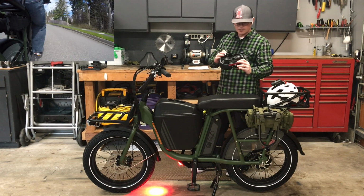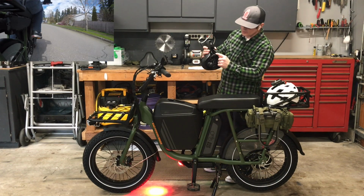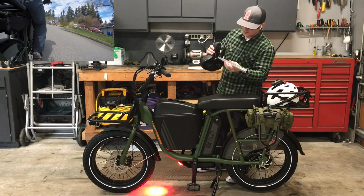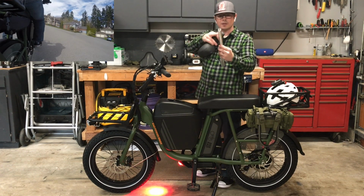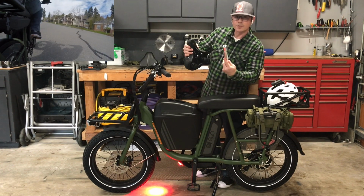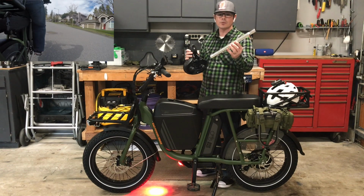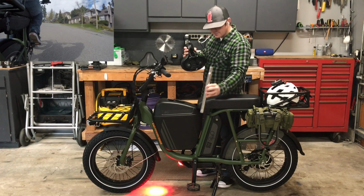Again, I wish I could use this. It just doesn't work. It sits too tall. The seats do come with a hole for the peg to go in for the post, just like this. This particular post came off of one of my other bikes. You can see maybe that it's tapered, and it's important that you guys know that. You don't just get a seat post that's the 27.2, by the way, which is the diameter around the post. That's what fits this bike.